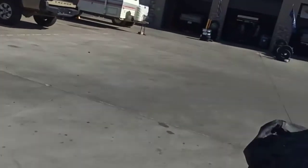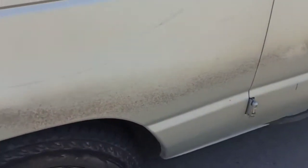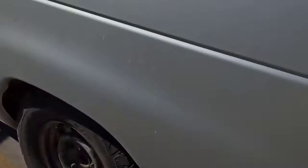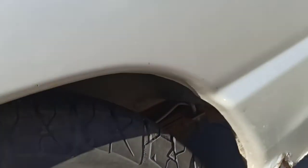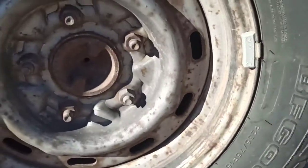These tires they were selling are rated for under a thousand pounds — that's two and a half times less than my tire requires. My tires are originally 1,908-pound-rated, and the extra load version is 2,395 pounds. That's per tire. So you could literally add 600 more pounds per tire at max pressure — it says all this stuff right on the tire.